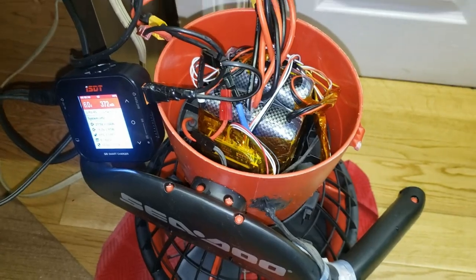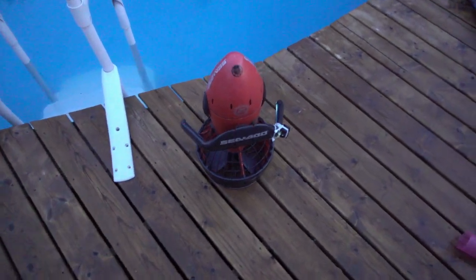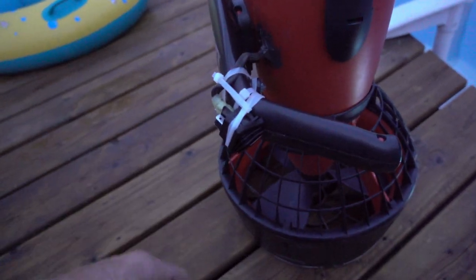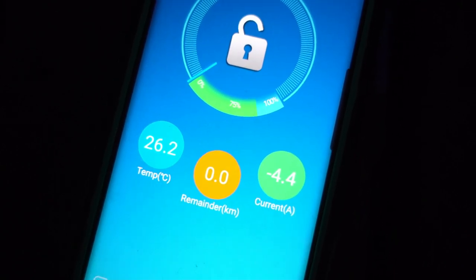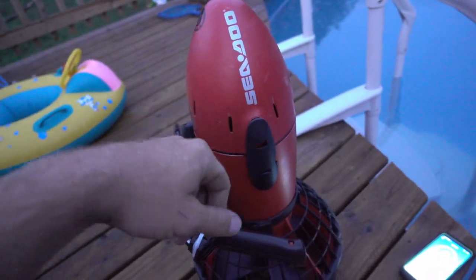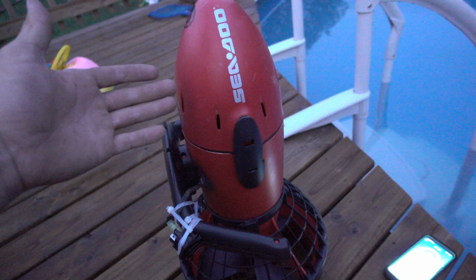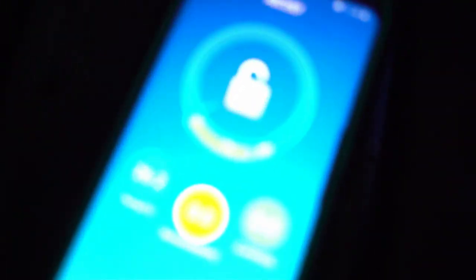Here we go — one guy going off grid and we got the underwater scooter, the fully modified one. I stuck an underwater switch on it, it's just crudely attached because I just want to get this working for the weekend. Running with no load we have 20.8 amp hours worth of batteries at 4S, 3.7 volts nominal per cell, so that's 16.8 volts full charge at 4.2 volts a cell. We are sitting at 75 percent.